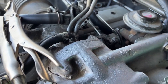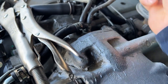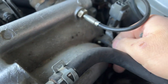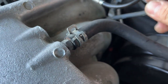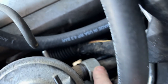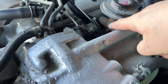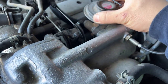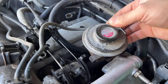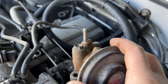What we're going to do is just cap it like that — take one and cap it, and then this one over here we're going to remove and get a cap for it. They sell caps or you can fill it up with PVC. For the big nut right here, this one just needs a vice grip. Then I've got to loosen these two 12mm bolts, and this piece — half of the EGR — will come out. Once you remove the two 12mm bolts, this EGR piece comes out like that.